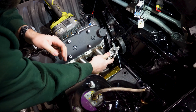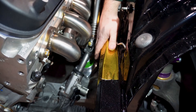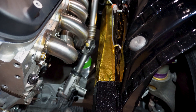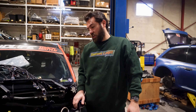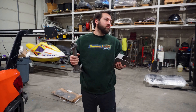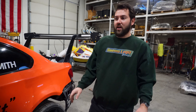Now if I can line this up right — put the steering shaft in. Voila! This is an E92 M3 steering rack. The E92 M3 rack has a better ratio, makes your steering wheel feel a lot better. It also has this little dongle on it. Because the E92 M3 had a V8, it definitely helps with the V8 headers. We're super happy with LS E90 — this stuff just really makes the swap super easy. Even if you are swapping this or another car, making engine mounts kind of sucks. You've got to do it more than once because usually the first time isn't perfect and your angles aren't always right. So because of LS E90X with the headers and engine mount, it just makes the swap tremendously easy. It saves countless hours and it's super affordable — it's totally worth spending a thousand bucks, it will save you that and 20 hours worth of work.